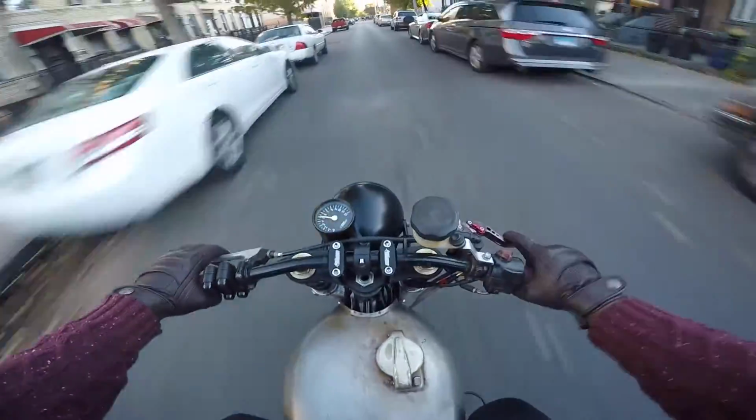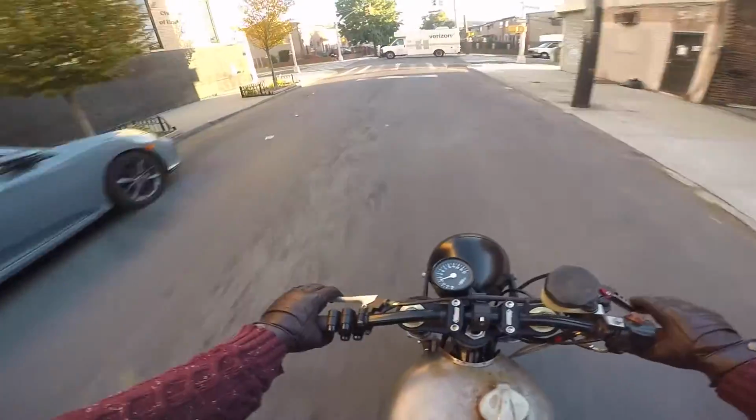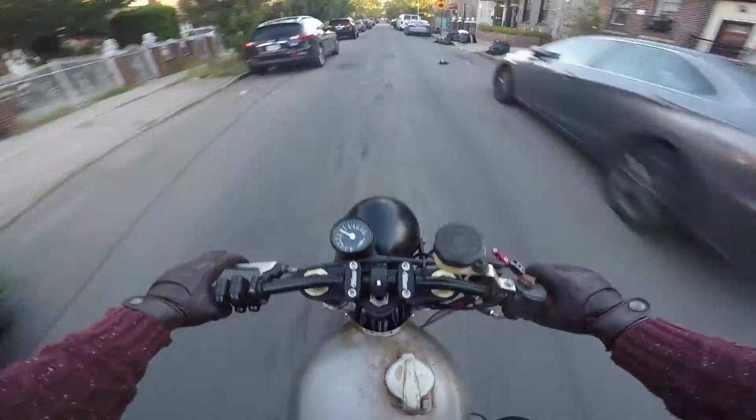I continued to ride the bike over the next few days, and some problems that came up included dead brakes, which indicated that the rotor was pushing the piston back as the wheel spun. I had an issue of the headlight flickering out, as well as an issue of the key slot for the ignition vibrating into the off position when the bike was revved too high.